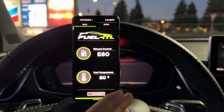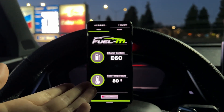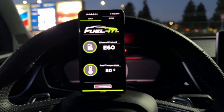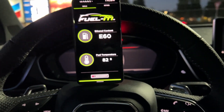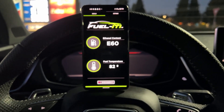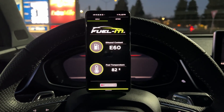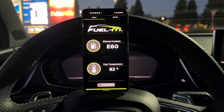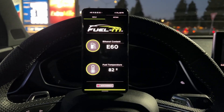It's important to note that this process of waiting for the ethanol content to rise to the minimum amount is the same regardless of whether you're flashing via a laptop program or a map-select system integrated into the MMI. You can't really avoid the time it takes for fuels to switch over unless you're running a fully flex fuel tune, which we have in development at this point. In the meantime, this is the process involved.